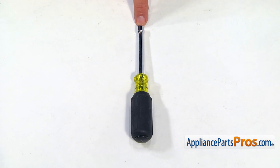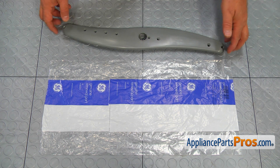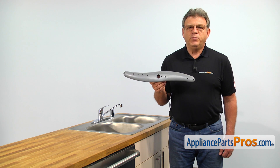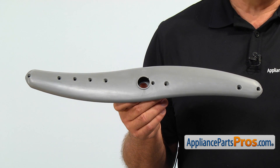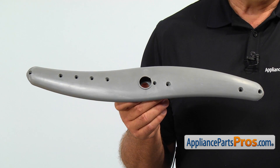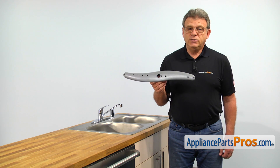For this job, we're going to need a quarter-inch nut driver. When you open up the package, you're going to get a new middle spray arm assembly. The middle spray arm rotates, shooting up water, washing the dishes in the upper dish rack. The main reasons why the middle spray arm would need to be replaced are if it gets clogged with debris and hard water deposits, or if the bottom of the spray arm separates from the top. All of this will cause the spray arm not to move properly.